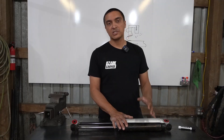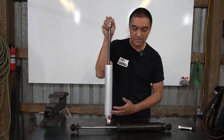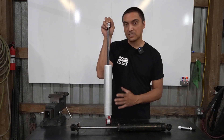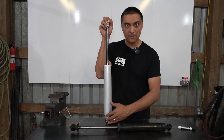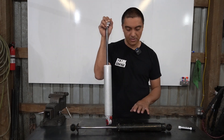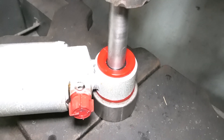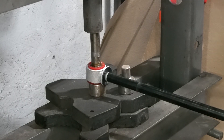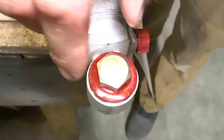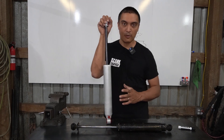So I set about looking for a long travel shock that was adjustable — my thought being I could set it soft for the trails and then harder for on the roads. I came across these Rancho RS 9000 series shocks. As far as adjustable shocks go, they're not very expensive and they've got nine adjustment settings from soft to hard. Dimensionally, they're almost identical to the Monroe shocks I had been running, but these had a half inch sleeve in the bushings instead of five eighths, which I needed for the Truggy. So I had to make a couple tools to press out the old sleeves and press in new sleeves, but otherwise they should fit just fine.